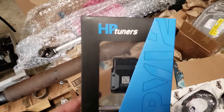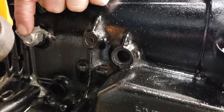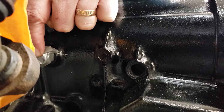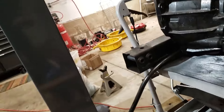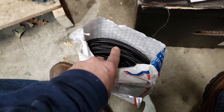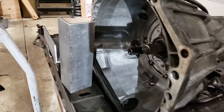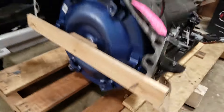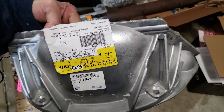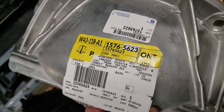The last thing is tuning — I'll do a segment swap and then deal with transmission lines. The transmission cooler lines are different on the 4L80 than on the 4L60, so you'll either need to lengthen the ones you have or get new ones. I've got some lines from an old project I might try to use, otherwise I'll extend the existing ones. One other fundamental difference: on the 4L60 the bell housing goes all the way around the torque converter, whereas on the 4L80 it does not, so I picked up a dust cover — I'll include the model number and a link in the description.